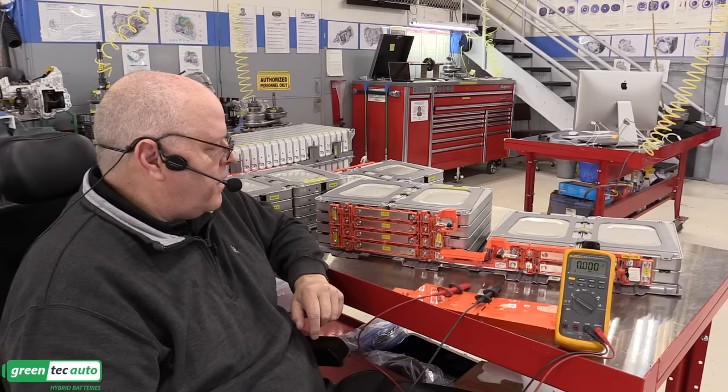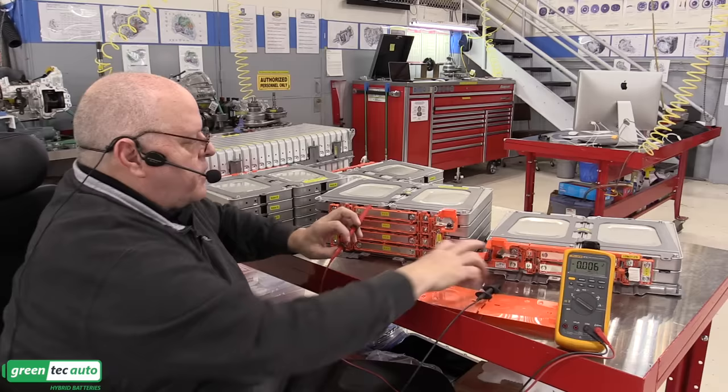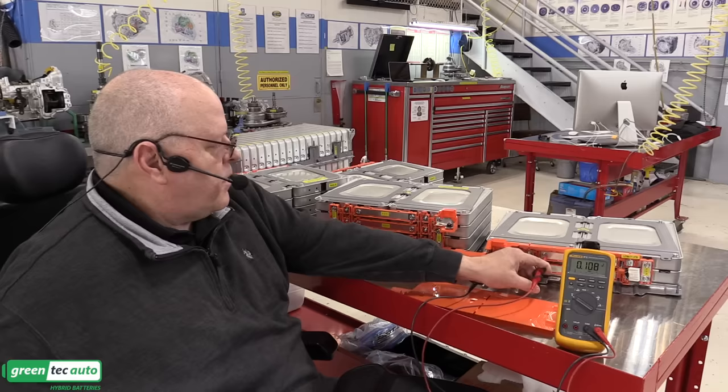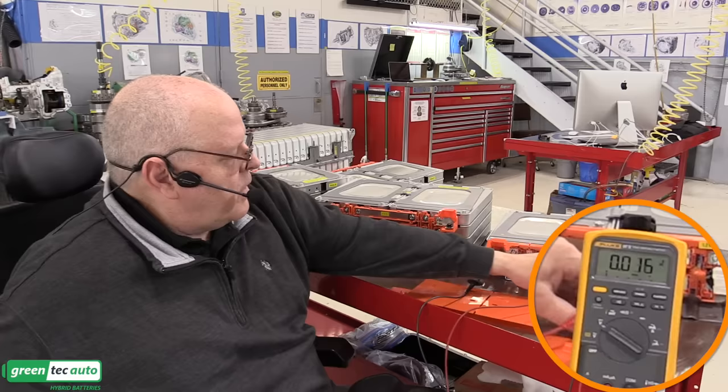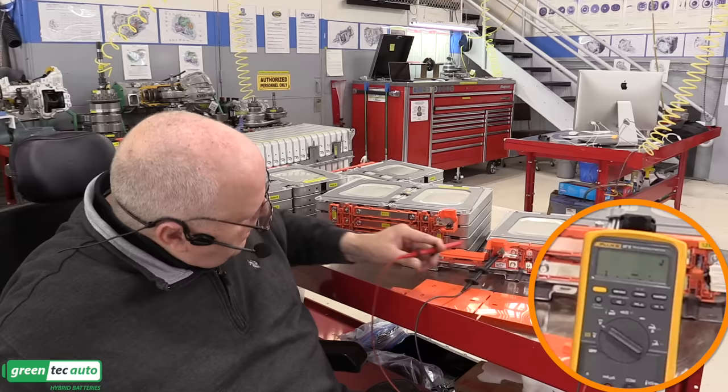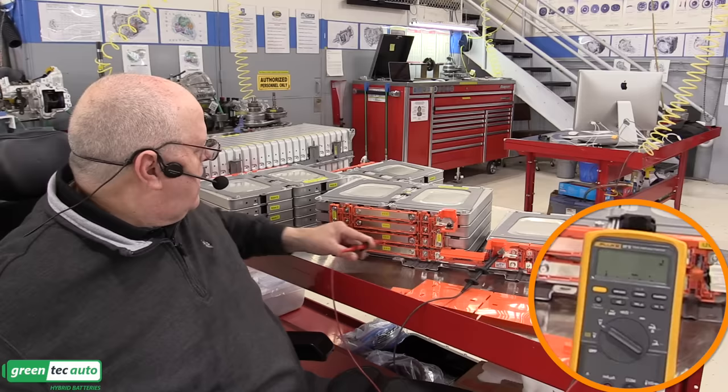All right, let's take some more measurements. So if we go from, let's see, this was battery negative right here. If we just go over to the first bus bar, there's our 7.8 volts for that module. We go over to the second bus bar. Now they added together at 15.68. If we come back to the third, 23 volts. Go clear over here to the fourth, 31. 39.